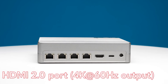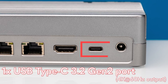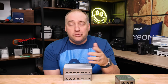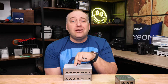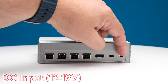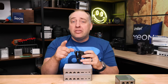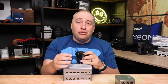There's also an HDMI port, which you see fairly often, and a 10 gig USB-C port which is a USB 3.2 Gen 2 port. If you wanted to run a digital signage display, a Home Assistant display, or something like that, you actually have two different display outputs because this uses the Intel Alder Lake N series CPU. The last feature is a DC input — 12 volt or 19 volt — with a standard barrel jack, and there's also a USB-C Power Delivery option if you want to power it that way.